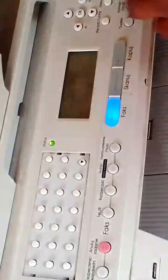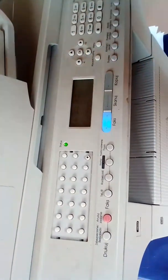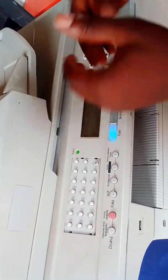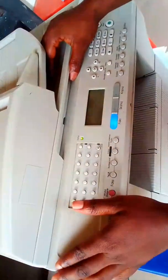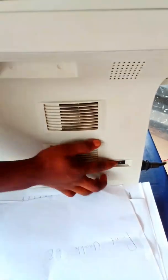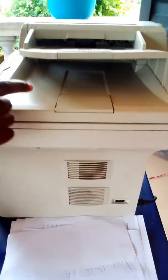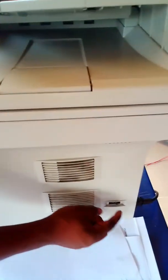So, to clear that — can you see the screen of this machine? This is my machine. It is not showing the error because I had to clear it. But I am going to show you how to clear it in case your own shows that way. It's very, very simple. Now let's get started. If your machine shows Print Unable 6B, like I just showed you on the paper, what will you do? All you have to do is just come to this power button and off the machine. Then you are going to do a two-key click. You come to this other key, hold down the menu button, and whilst holding the menu button, the other hand switches on the machine.